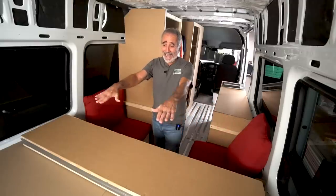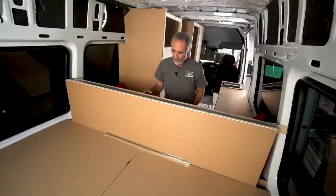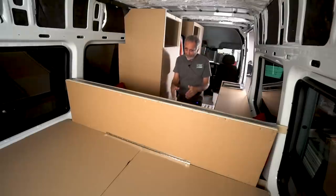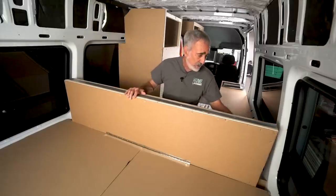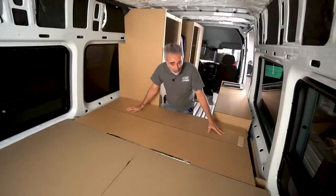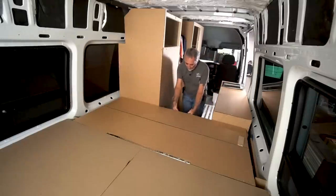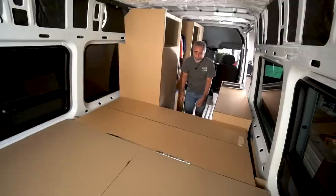During the day you'd have a stacked folded mattress visible — I don't want to see that. So I built a platform that acts as a blind to hide the folded mattress. You just see the puffiness up top, and you have your dining area. When it's time to sleep, you put your seat cushions down, release the stop, bring the platform forward as a structural extension of the fixed bed, then unfold the mattress for a full bedroom. Stairs live under the refrigerator — you pull them out and step into bed.